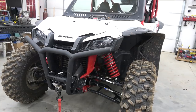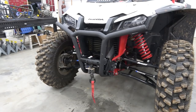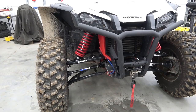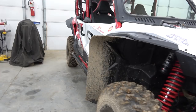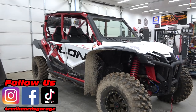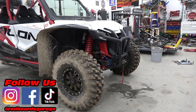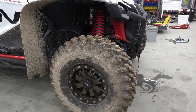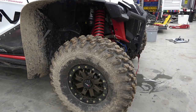We've done a little bit of riding on this front end to let everything settle, and of course I can't tell a difference — which you shouldn't — because this is not going to affect your ride in any negative way. You're just getting more clearance and a lot more strength with this whole setup. I really do like it. With the 32s on a Talon, this made a tremendous power difference on the negative side — being a 104 horsepower machine, 32 inch tires is a little bit much for that little engine to pull with four people. So a turbocharger is in our future. But these tires grip — you can tell by how it bogs the engine that they're hooking and getting. I'll put my stock front tires back on when riding around the house and throw these on when we go to the trail. I highly recommend all these parts — super strong.